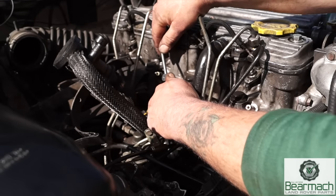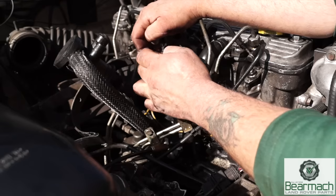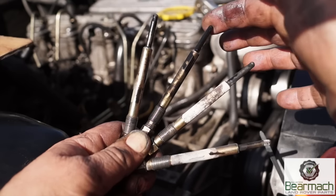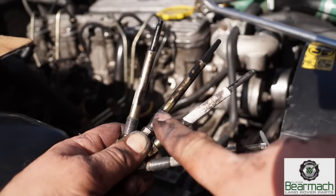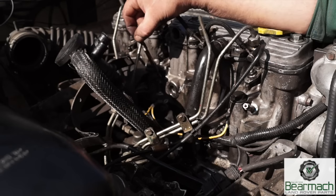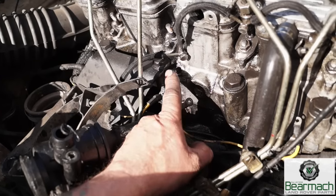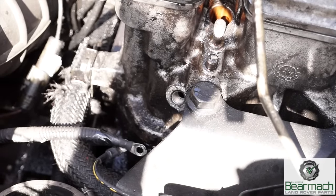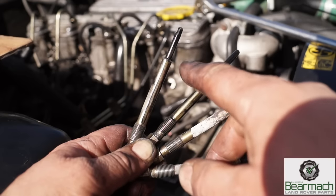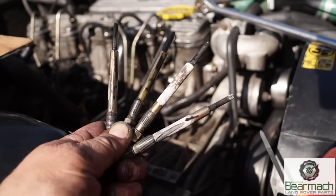Removing a glow plug — you do not need a large bar. I have a quarter inch drive with a 10mm socket on it. I've cracked it off and I'm turning it forward and backwards to loosen the carbon so I can get the glow plug out. We're looking at our glow plugs and yes, we do have oily glow plugs. I've pulled it out and it has oil on it. I could think that the oil has been dripping onto the cylinder head and as I've pulled it out it's drawn it through the oil. That's number three glow plug. There was a lot of oil on here, but I suspect because number four has no oil on there, we are actually having oil in these two cylinders, which is not a good sign at all. The glow plugs also haven't been working recently. If you look, we have some white powder residue here — this is some sort of anti-seizure powder, which is good. Whoever put those in was thinking ahead.